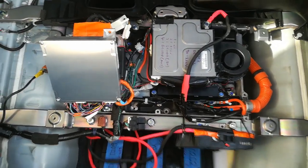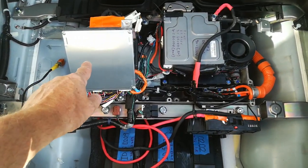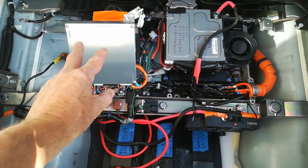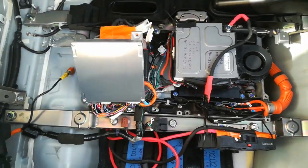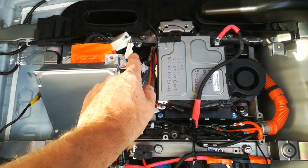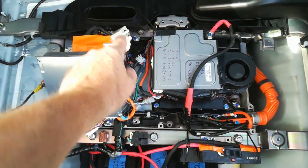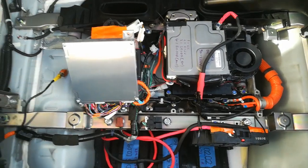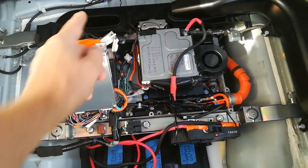I just made a silly mistake — I had one of the RAS connections the wrong way around. So I've put my other MCM in, which has the correct rotor position calibration completed. The other one wouldn't let me complete that for some reason. I've also swapped out the battery current sensor, but I'm still getting a battery current sensor error — only about 5 seconds after you start the car. So I think the calibration is wrong for that.